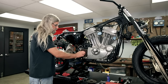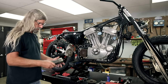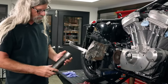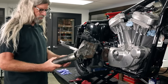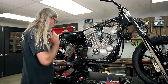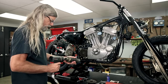In order to loosen this nut, once again there is a tool to lock this, but not everybody has that tool in their garage. So we're going to use this — what I use for Big Twin and Sportster — and it is an inch and seven-eighths socket. The reason it's so long is because on a Big Twin the main shaft's sticking out there. I'm going to use a half-inch impact. It's a left-hand thread, so not righty-tighty lefty-loosey — it's the other way around.